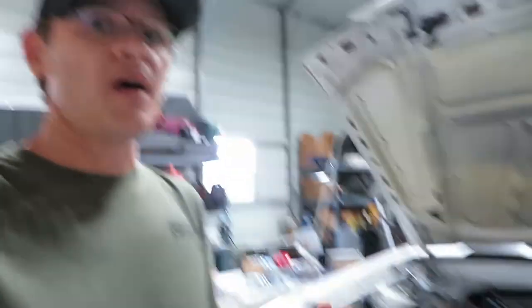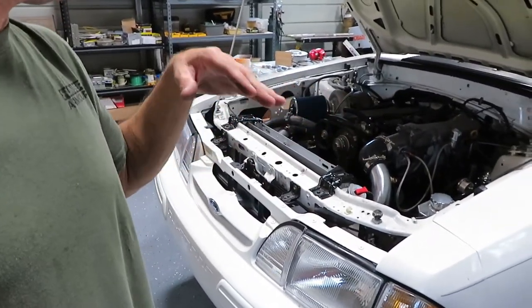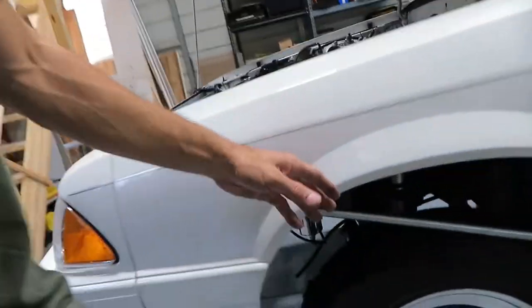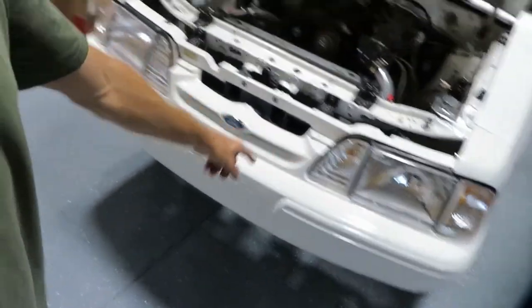I wanted to better explain how this works for new guys buying these cars. I'm a member of a lot of forums and I see questions where you can tell they don't know much about this stuff. Weight also matters — I've tried to take as much weight off the front of the car as possible with the manual rack, the Team Z K-member, and eliminating stuff you don't need like the fender plastics. The front bumper core support is gone too — I don't drive this on the street anymore, but when I did I kept it because an accident without it would be pretty bad.